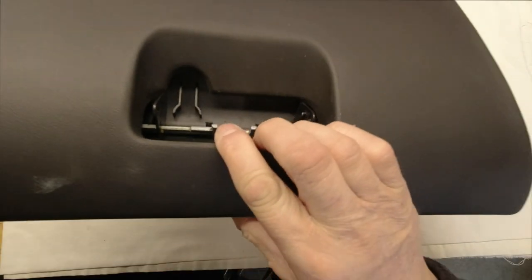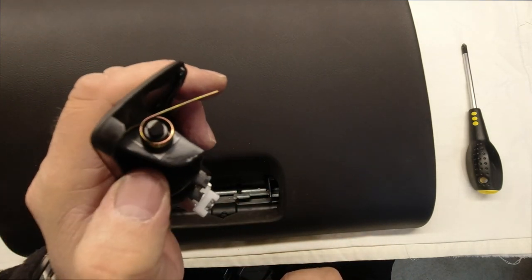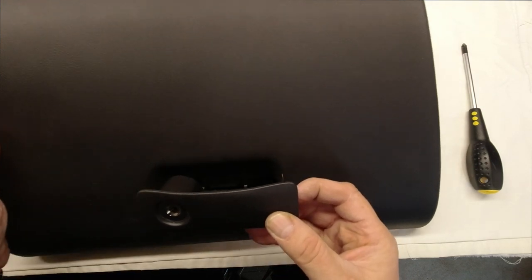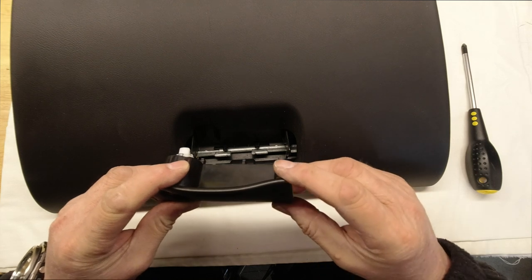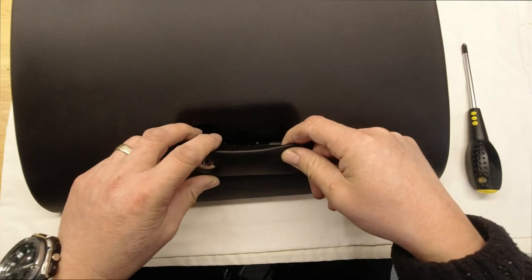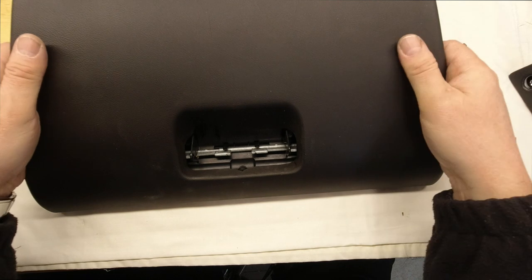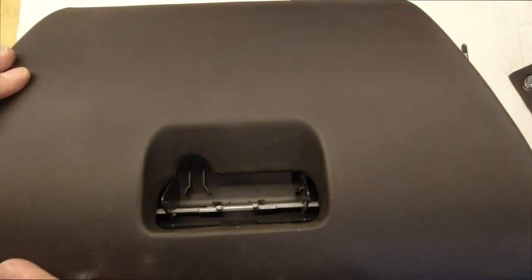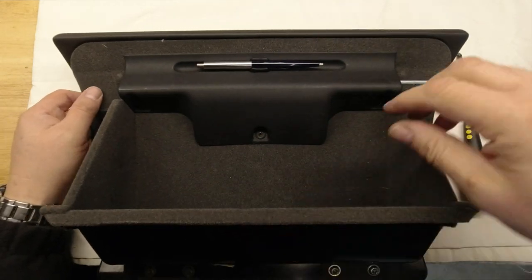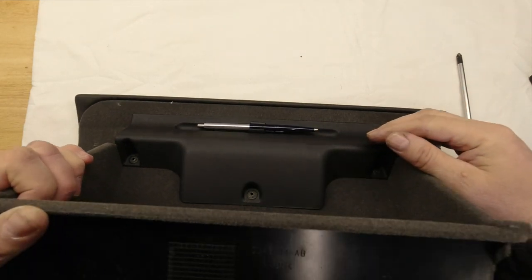The lock handle just works these pips here that stick out. So if I was going to snap this into position now, what I'd be doing is get it on the arm in that orientation — this is the way up the whole thing is supposed to fit — and bend this lever down, hook it underneath like that, then proceed to force it back into position. But today, because we're going a little bit further, I'm going to take you inside this glove box door. This panel hides that mechanism from the interior and it's held in place with three pop rivets.